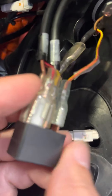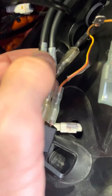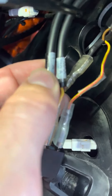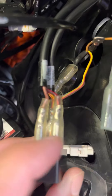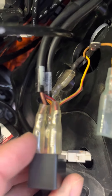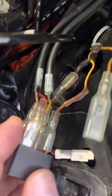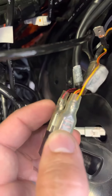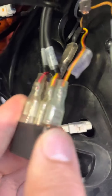All you're going to do is take the positive and negative off ACC2 — this is the ACC2, and it's only the 1-amp power — and plug those into the parallel plugs on the top of the relay, positive and negative. I don't think polarity really matters on the relay trigger side.